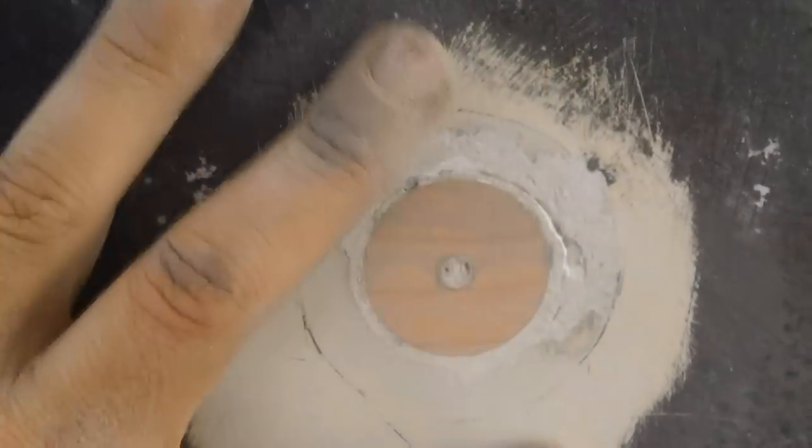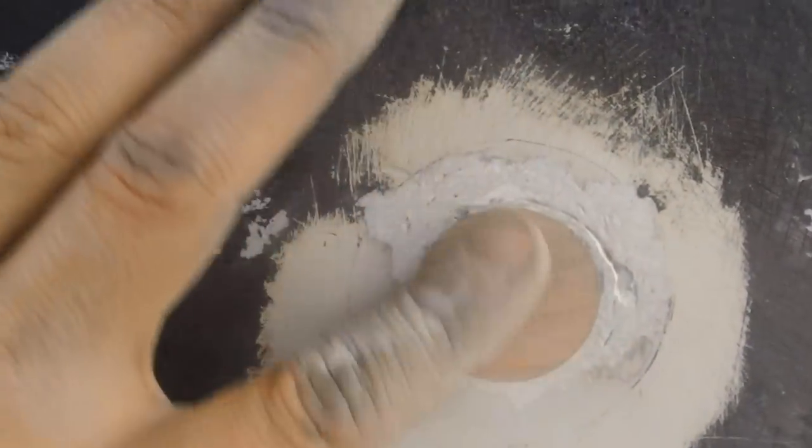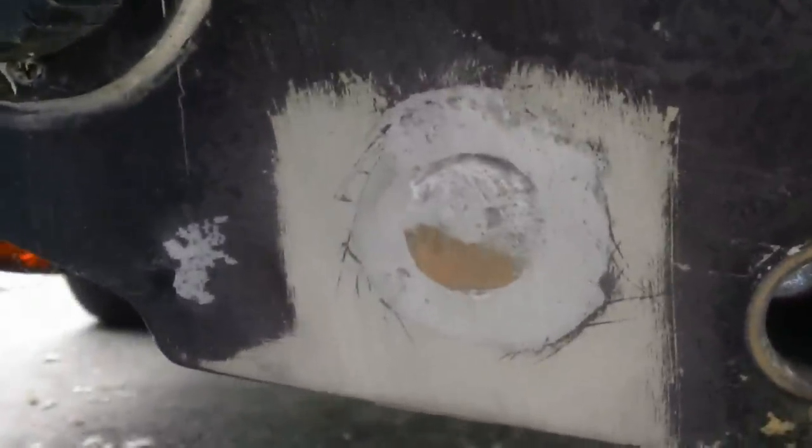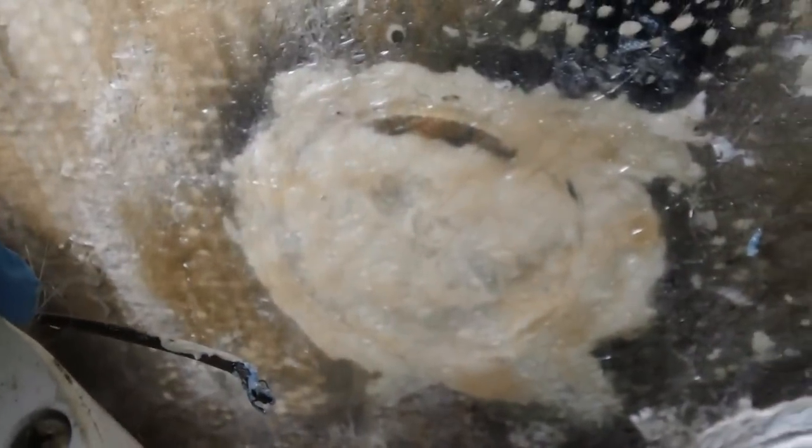If you were to close your eyes and rub your finger over this, you wouldn't feel it at all. This one here is about the same, except you can see a tiny little area where the MarineTex shrunk and left a small divot. That's going to be taken care of when I put the fitting in and drill the new hole. Here's a look at the fiberglass mat over the first hole, and I'm about to do the fiberglass over the second hole.